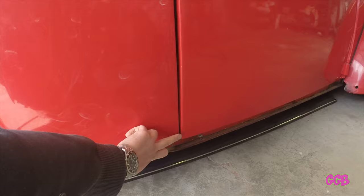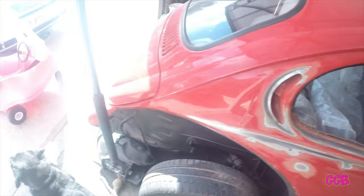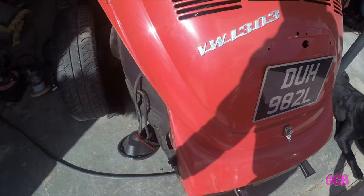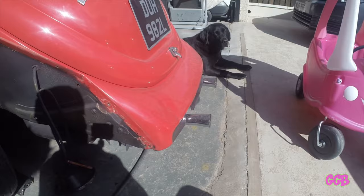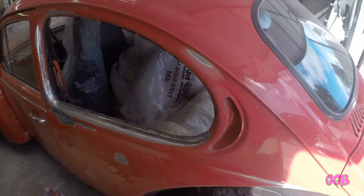There's a little bit down here you probably won't see with the camera. There's a few bits — it looks like it may have been filled in before; I'll try and make that look a bit better before priming. You can see the damage down here where he's run into it with his lawn mower — there's a big crease, mostly paint split. Need to try and get in behind there and bash it out. Same on this side.